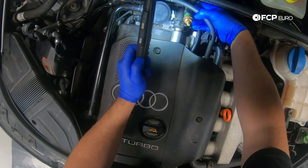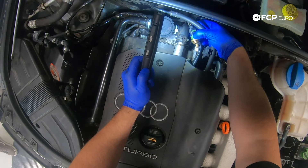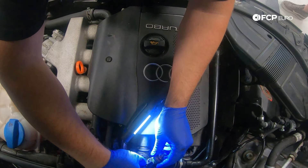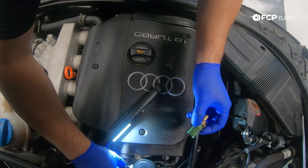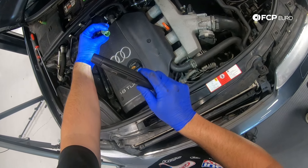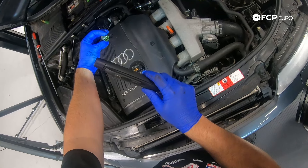As you can see, the sensor came out. It is easier to pull it out with the wiring harness, but the O-ring is still in the pipe — so you need to get a pick and get that O-ring out of there. As you can see on this car, it was leaking coolant through the sensor, so hopefully we can clean out the wires enough for it to read correctly again.